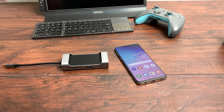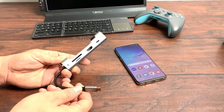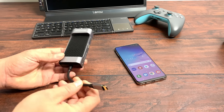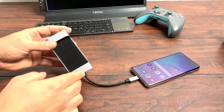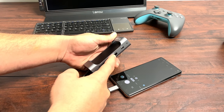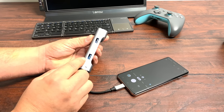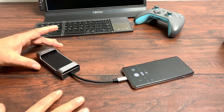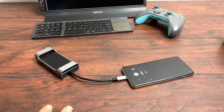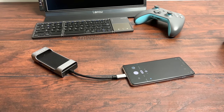Keep in mind you don't really need to buy a portable setup. If you just want to plug into a monitor or TV you already own, all you'll need is a USB Type-C to HDMI adapter. The one I have here has a full-size HDMI out, SD card slot, USB Type-C for power in, two USB 3.0 ports, and even Ethernet. It works great when I want to connect to my big screen TV or HDMI-enabled monitor. You can find similar devices on eBay or Amazon for anywhere from $10 to $30.